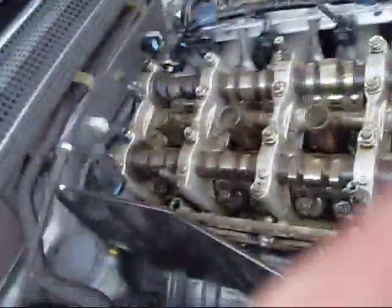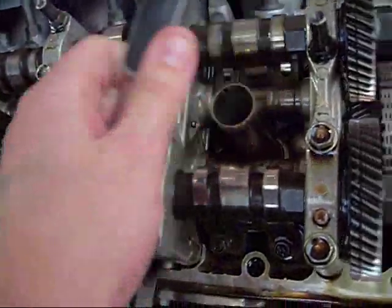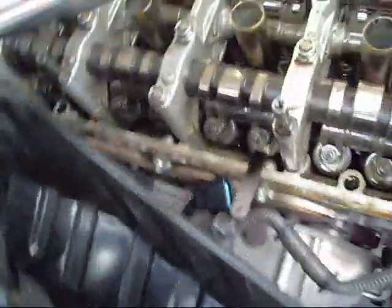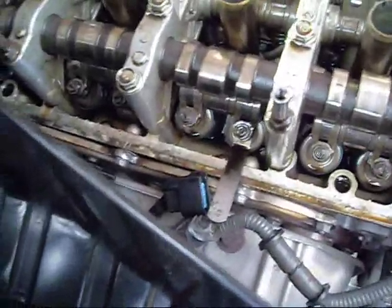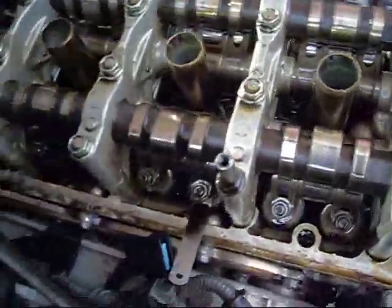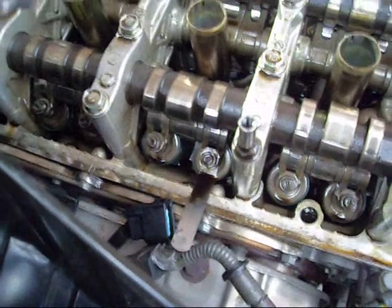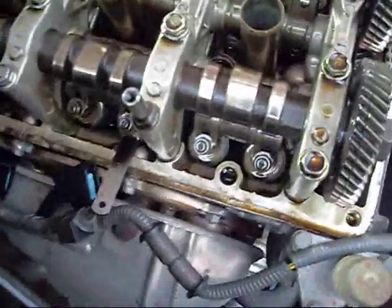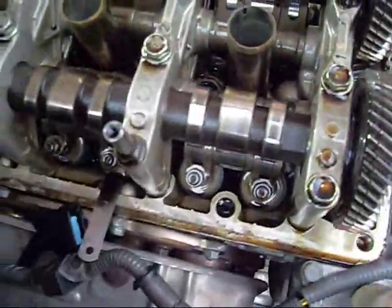Because of the torque placed on the screw, it has sufficient friction to overcome that of torquing down the nut securing the tappet. That's great because instead of fiddling about holding a screwdriver, I can just get my socket, make sure it's set to clockwise for tightening, put it over the nut, and torque it down. I should probably use a torque wrench, but I'm a sufficient enough mechanic to know how tight they need to be — fairly tight, but don't go hanging off the wrench or you'll strip a thread.